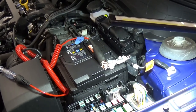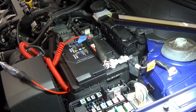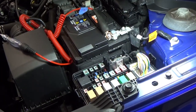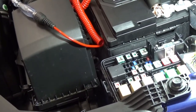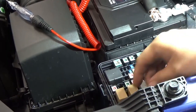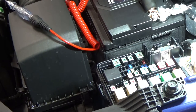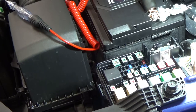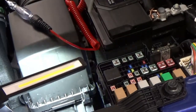Okay. So, I don't know if you will hear that too, that when I press my horn on the steering wheel, I can hear our switch is clicking. So our relay is clicking. That means I think we have a good switch there from the horn. So I'm just gonna go straight to our component, the horn itself. I will check our power there.